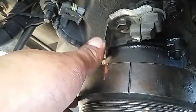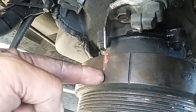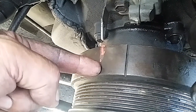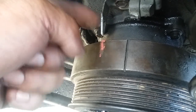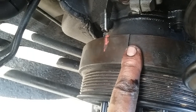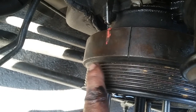This is the dead point for this engine, right here. This line has to go right here. If it's moving or something keeps moving, just make sure when the pulley starts to move it's not going anywhere — leave a mark at the dead point. This is the timing mark; the alignment is very important for this pulley.